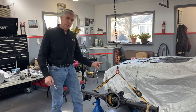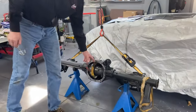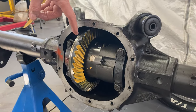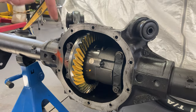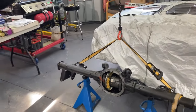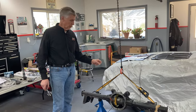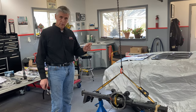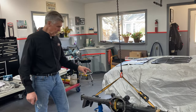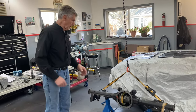Whatever way you do it, you've got to verify the gear pattern. You paint the gear teeth with yellow paint made for that purpose. This is actually the coast side — the drive side is hard to see from here. You want to get the contact pattern in the middle of the tooth as much as you can — not too deep in the tooth and not too much toward the edge. There are lots of examples of correct patterns on YouTube.